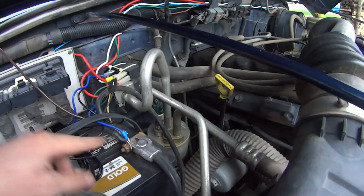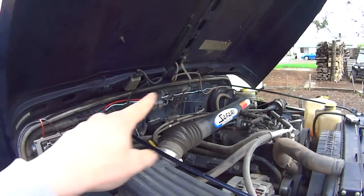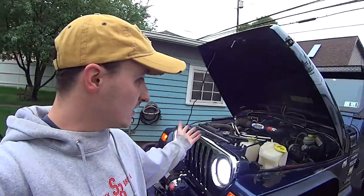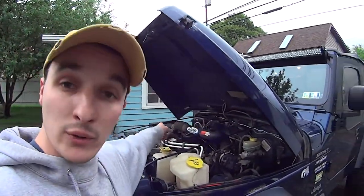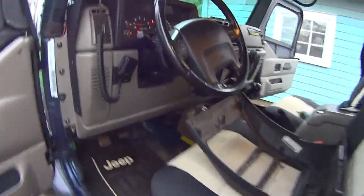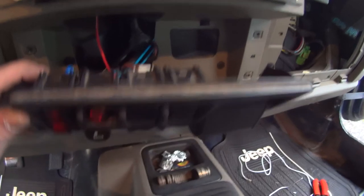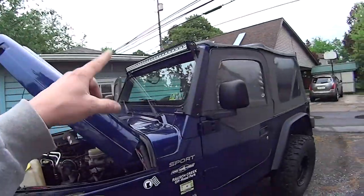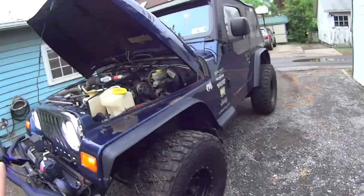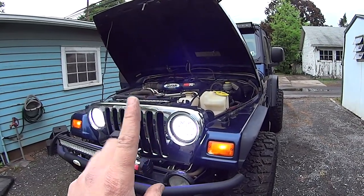We're hooked up here, we're hooked up here. We've got our relays — this is for the light bar we just installed, this is for the little light bar I had before. All my wires are following the factory loom so that at some point I can run loom over it and make everything look nice and tidy. If I get real brave, I might even put relays in the relay box because there are spaces. As for the switch, I tied into the same switch for the little light bar and ran the signal wire, which comes from the headlights, to the same switch. So that basically means as soon as I flick that switch, the top light bar and the front light bar should come on at the same time — the headlights have to be on. I turn the headlights on and then flick the switch — let's see what happens.